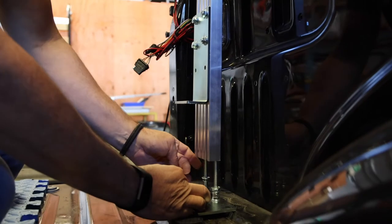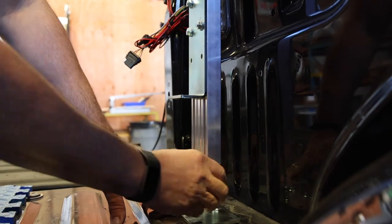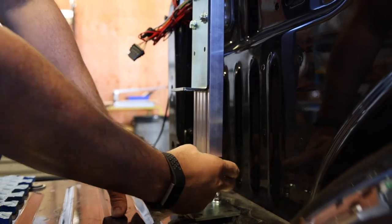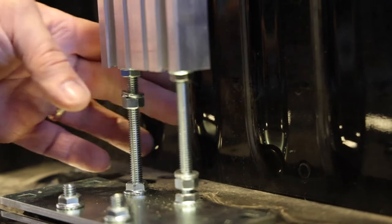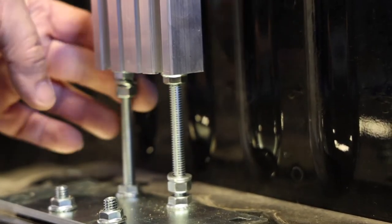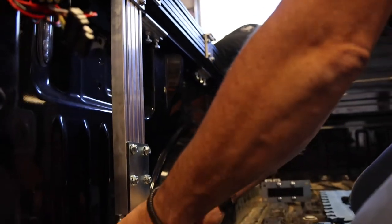As you can see, you can dial these nuts up, which will apply pressure to the feet and to the rail. This is what gives us the structural stability of the Truck Boss deck. As you adjust these up, just make sure there's good tension on this tail leg so that when you wiggle it, it does not move. Once the tail leg is tight, go ahead and loosen this top L bracket, then slide it down onto your bolts.